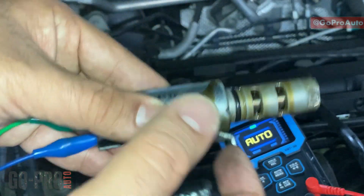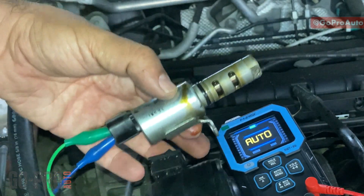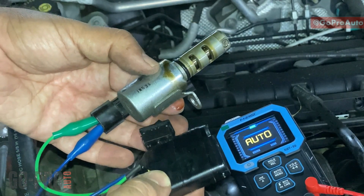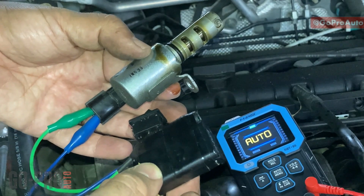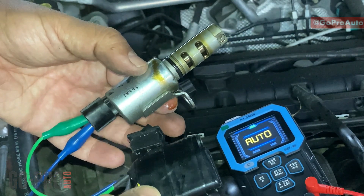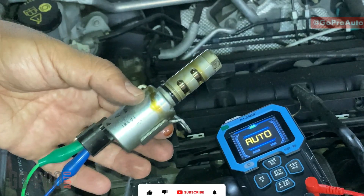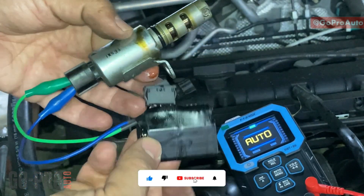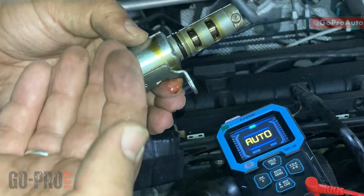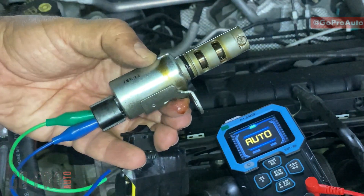This is the best and safest way to check the solenoid valve. Some workshop manuals ask you to activate the solenoid valve while it's on the engine while the engine is running — doing that should cause the engine to run very rough or stall — but I prefer to take it out and check it like this. In summary, you can check the power supply, the ground, the internal resistance, remove and clean it, or actuate it with a battery to confirm it's working. If on your engine you see something different in any of these steps, the problem is in that area.